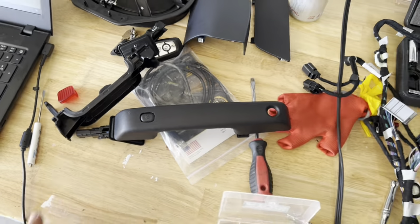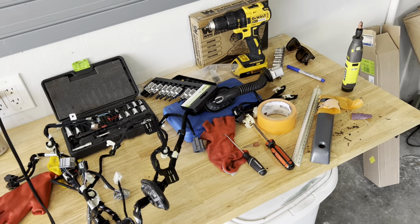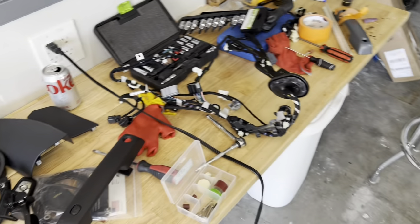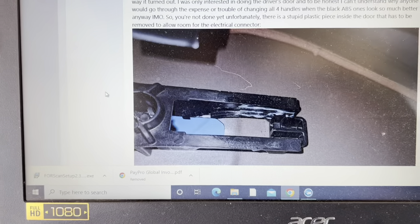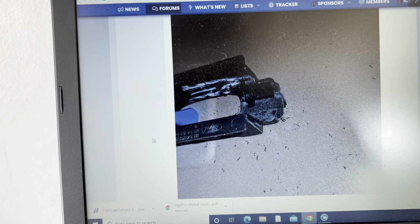We got the hole open and got it installed — I did an okay job. Could have been a little tighter but I'm pretty happy with it. Definitely take your time with this; if you're not comfortable or think you're going to screw it up, find a buddy who knows how to do this. The next step is there's also a piece in the door that needs to be Dremeled. This little channel needs to be cut into — I've got to put the Dremel in there and cut a little slot to make room for the wiring. Here's the diagram from the F-150 Lightning Forum, which I'll also post in the description. I'm going to do that step without recording since it's impossible to film.